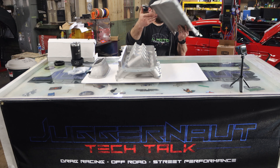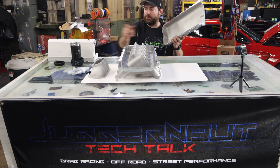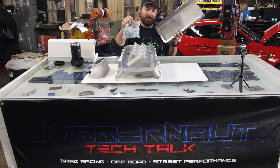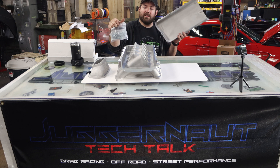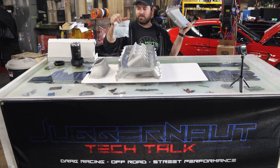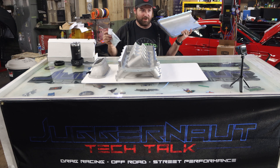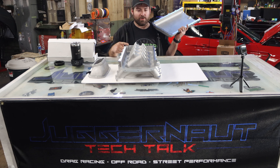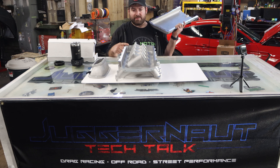So now this is the lid. You'll see it has an O-ring surface. O-rings come in the bag. There's a bolt bag — all the bolts you need to put it together. Some nice 12-point nuts. There are plugs for every port. Now make sure you put the gaskets in. If you put a Whipple lid on you probably know — put a little bit of clear silicone grease on these gaskets to help hold them in place in the corners. It won't hurt anything as far as sealing.